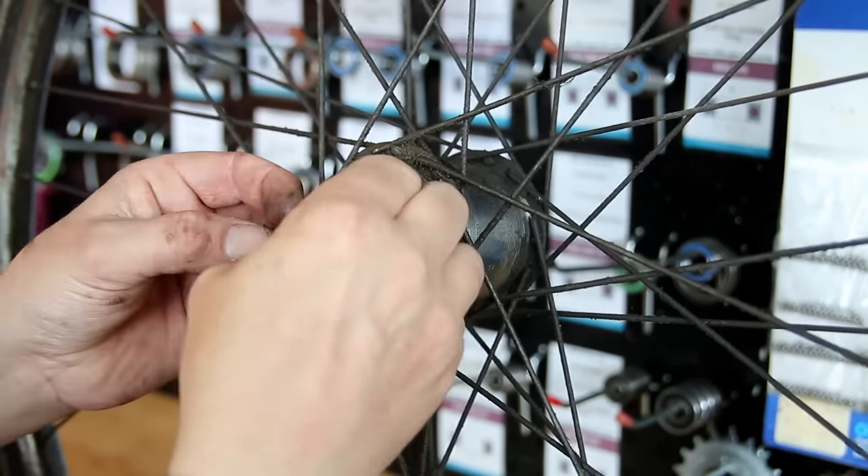I'm also using a toothbrush — simple but easy for getting behind the spokes. I'm really cleaning this hub up and checking the integrity of all the spokes. I'm also working on the rim using wire wool to get it much smoother so that when the new pads go on they're not grabbing old rusty parts. Unfortunately it's a trait of these rims — at this age most of the chrome surfaces have some rust or deterioration.